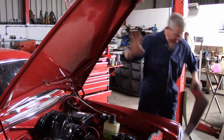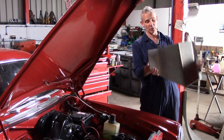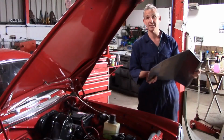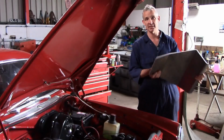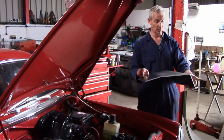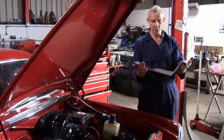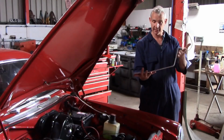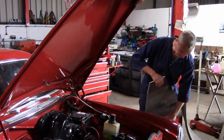However, our 8mm 6082 aluminium steering guard that we've developed over the 20 years that we've been putting cars on the Peking to Paris and the London to Cape Town rallies, this is the one that works, all pre-formed and manufactured by us for us. So that's the steering guard, and then behind that